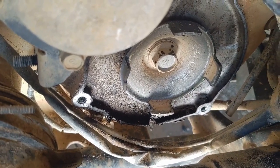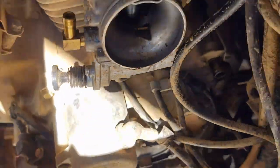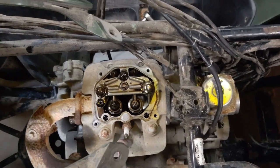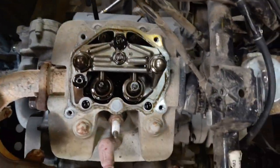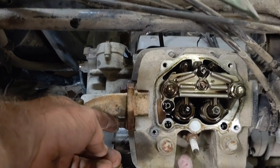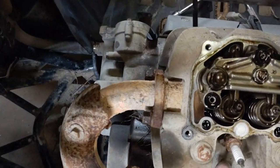That's what it looks like when you get the pull start off. Rotate the pull start up to the handles and pull it out from the top. Got the thing at top dead center - that helps in the reassembly of everything. Next thing we need to do is get some of these things that are holding the head on. The header has 12mm headed nuts - those things get hot and rusted, so spray some penetrant on there.